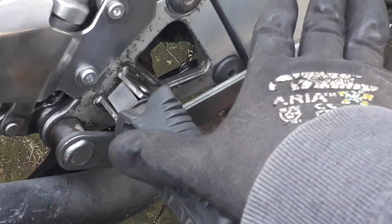brake. Alright, so as I was trying to get the fluid through the actual brake system, I was trying my best to push the lever down, put my finger over the brake caliper hole, and then lift up the brake lever, so in that way the fluid will get sucked through the system. But I was getting bubbles coming up through it, but then it stopped, and I was doing this. I had done this for a couple minutes, maybe near to 5 minutes or so, and I thought, why isn't this going through? Why isn't the fluid going down or the bubbles coming up?